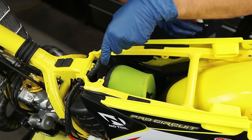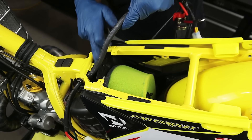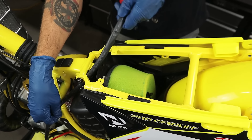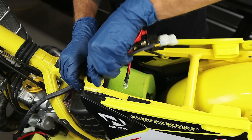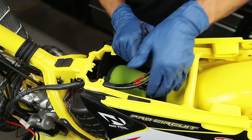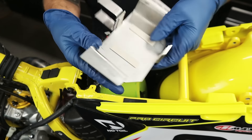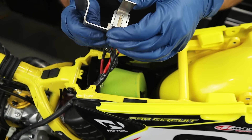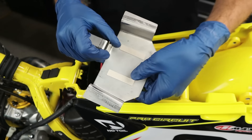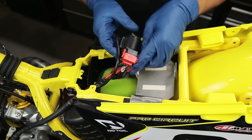I just found an easier way to do it — rather than forcing it through the little nook I made, just go in front of the airbox here, underneath the subframe bolt where you've got tons of room. You won't scrape anything up and it moves a lot easier. Once you get it where you want it, you can sort of force it down into that little cut we made earlier. Now we can go ahead and lay in our battery tray — it's very nicely bent, doesn't have any odd rub points, everything drops right in with ease. It looks like a piece of stainless so it's not going to corrode. It does come with rubber strips in the bottom so any vibrational shocks the battery incurs are cushioned.